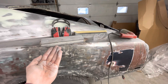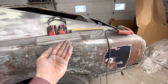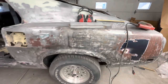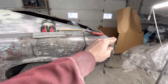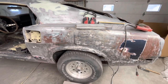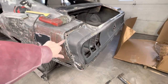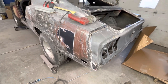If we went on top of the old panel that'd be easier, but then we'd have to build out because we're putting material on top of old material. If we go behind, we're building in - so our filler is only coming out to meet this rather than coming another eighth inch on top of that. I'll have to jack it up, take the wheel off, get all the welds on the inside, and I'm going to wait to do that final cut until the panel comes, just to be 100% sure. If I can get a lot of this drilled out, that's going to be one of our bigger time savers.